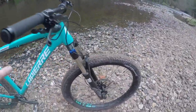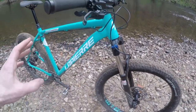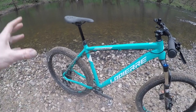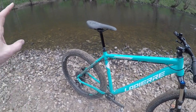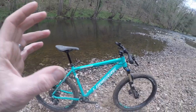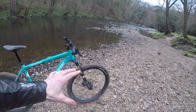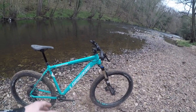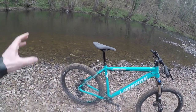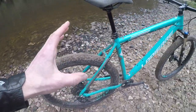On the downside, the steel stanchions on the Recon forks add a bit of weight, so the whole bike is just over 14 kilos in this large size — but that's ballpark for a bike with 2.8 tires. The handling is really well balanced: even with that narrowish bar it just pops the front wheel exactly where you want, keeps it there, and you've got plenty of stability.